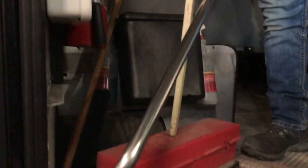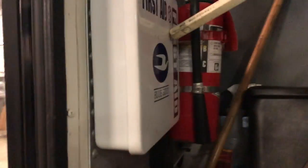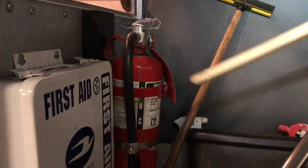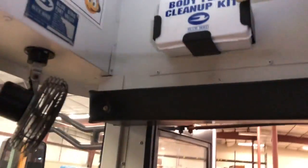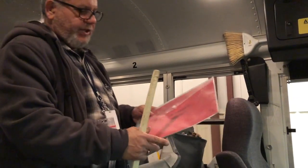I have three amber triangles in this box and they are secure. I have a first aid kit that contains no less than nine items. If this bus ran on fuses the extras would be in here, but this bus runs on a circuit breaker located outside the driver's window. I also have a fire extinguisher — I would make sure it is in the green, and once a week I would remove it, turn it upside down, and shake it. Up here at the top I have a body fluid kit — it is secure, fully stocked, and contains insurance information and emergency information.